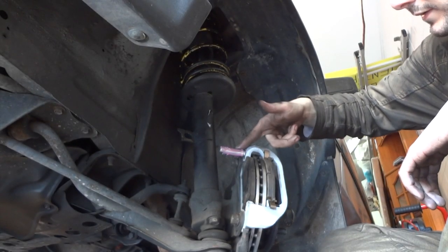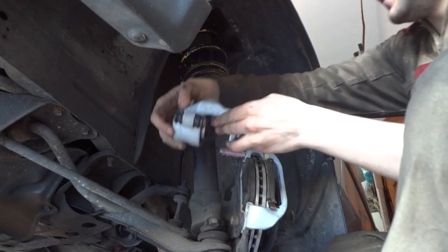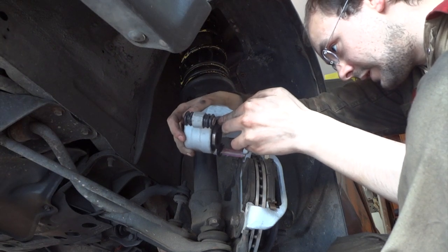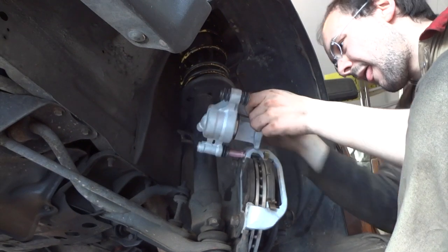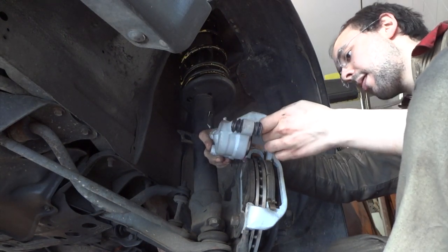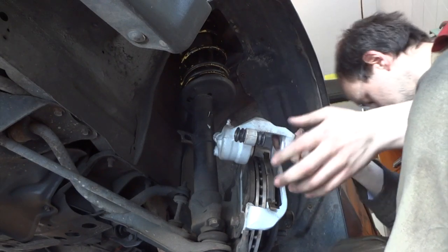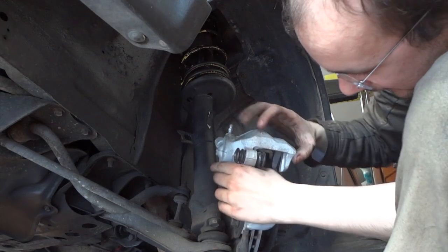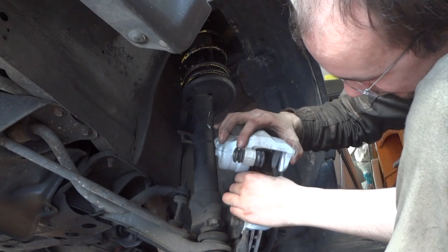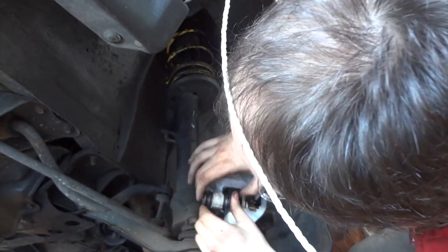Apply grease to the guiding pin and then slide the caliper from the top. Remove the air from the boot and then slide the caliper over the brake pads. Try to hold the anti-rattle shim into its place so that it does not move. Clean the excess grease.